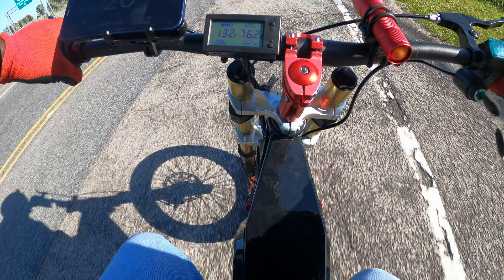I'm going to play with some of the settings on the controller. I got flux weakening set right now to 40 amps — I'm probably going to push that up to 60 or 70. And I'm going to charge the battery all the way up to 88.2 volts. So next video, hopefully we hit that 150 amps and go from there. This video was just a test — sorry about the wind and sorry about the camera angle, but I really wanted to catch the speed and the amps.